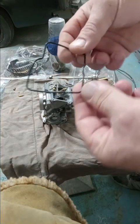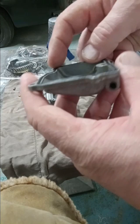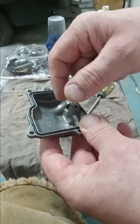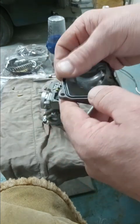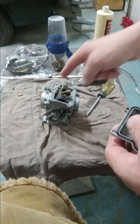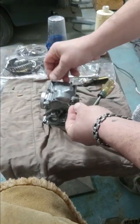Now we got the parts we need in it. This is the new gasket — this is the one that was pinched flat. The main reason we took this whole carburetor apart was because this gasket kept getting wet and was smashed flat from too many years. The other problem was the jet backed out of the main jet and was touching the bottom — as soon as I took it off, I barely moved it and it fell out. I bought a whole rebuild kit and really only needed the idle air screw, the needle, and this gasket for the front carb. You can tell that's a big difference.